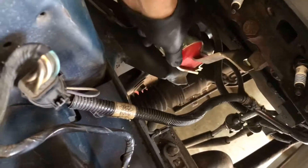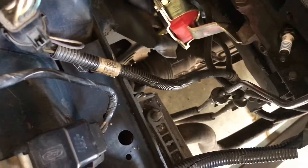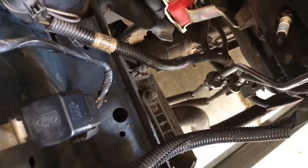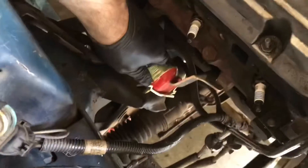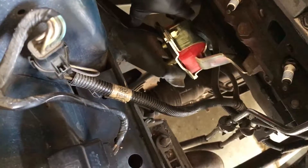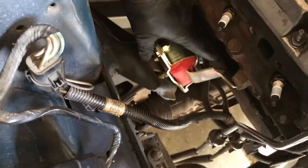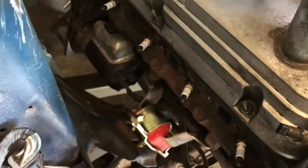Alright, so I've got this new one in place here, just kind of hanging in there. Had to lift the motor up maybe another half an inch. I'm just going to get the nut started on the back of this bolt, and then I'll get the bolts going into the engine, into the block. I'll probably go ahead and tighten down the bolts that go into the block and just leave this one loose while I do the other side.